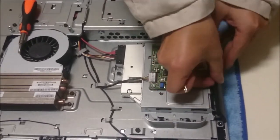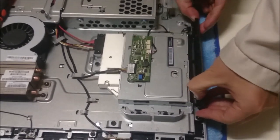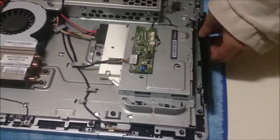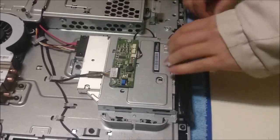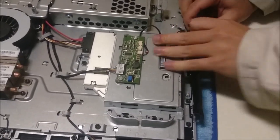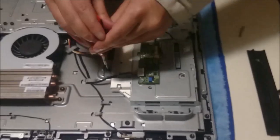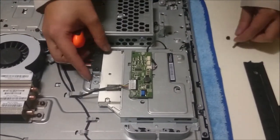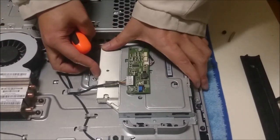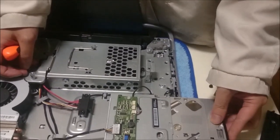Now with the DVD drive, you have to remove the front plastic. Just tilt the front back and forward a bit and it'll pop off the tabs holding it down — there are no screws holding the front plastic down, just wiggle it and it should come off. There's only one screw holding the DVD drive down; that screw actually comes off, so remember to put it aside. You just need to slide the DVD drive forward — the cable stays in place. It's a laptop DVD drive; it fits in tight, so just slide it back to put it back in place.